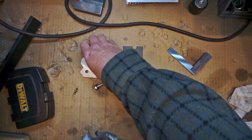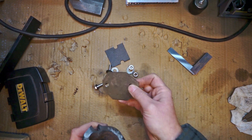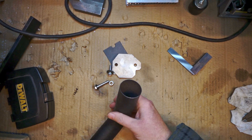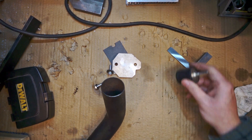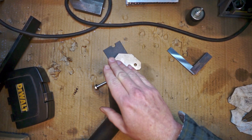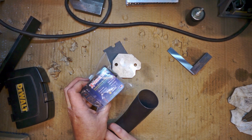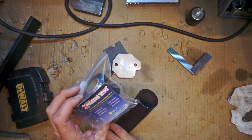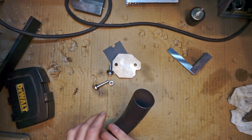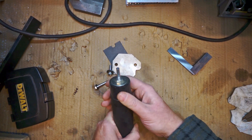For this side, I have a piece of scrap stainless cut out — it's an eighth inch thick — a little piece of leftover gasket and some bolts, just going to put that on the edge. For the other side, that was actually kind of a problem, but I found that if you have sanding drums laying around, this sanding drum works well. I also used this silicone tape — called Extreme Tape — that I bought for my pellet stove. It only binds to itself. With just a layer or two of that, this is a perfect fit.